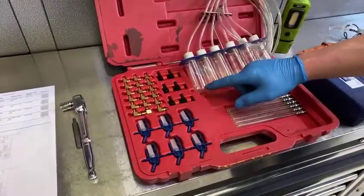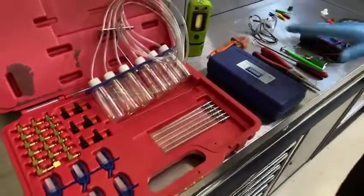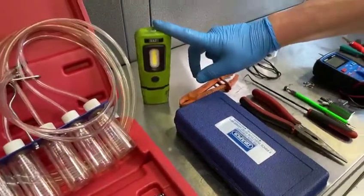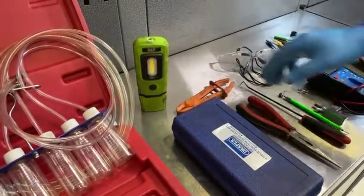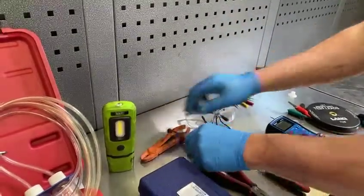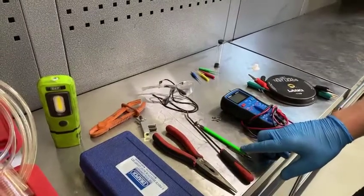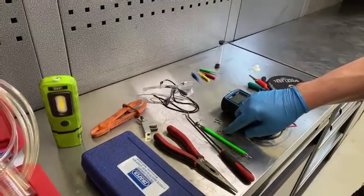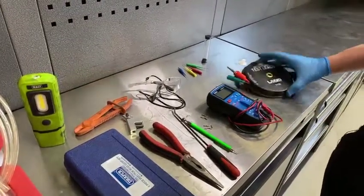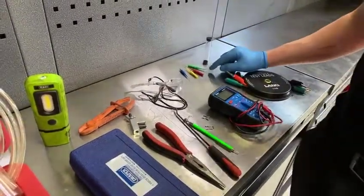This pot can go from 1 to 10 grams of fuel. We've got our noise tester — we're going to do a noise test as well. We've got our hand light so you can see what you're doing. We've got a couple of hose clamp tools to clamp the leak-off pipe, general pliers, a pick, a magnet if you drop the horseshoe clip that holds the fuel rail on, our multimeter, our leads for when we do our resistance test, and our back-probe probes as well.